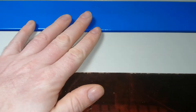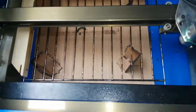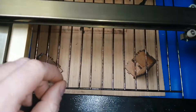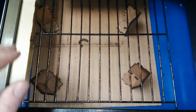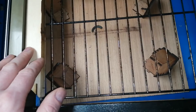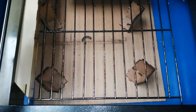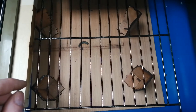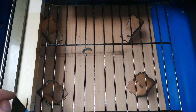I used a little bit of acetone. People say don't use acetone, just use distilled water because you can break down the seal — I didn't see that till afterwards — but I used a tiny little bit of acetone, got in there, and that fixed my issue. The laser actually works better than it ever has, so I'm assuming that bit of dirt was on there from the start. So just have a quick look, check to see if you've got any dirt on that little lens, give it a clean, give it a go and hopefully that should fix anybody's problems.